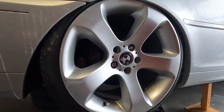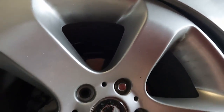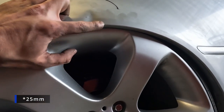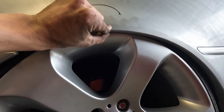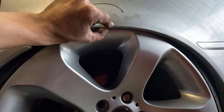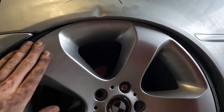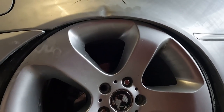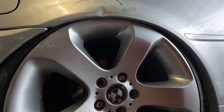Now I'm actually about to go in and roll the guards. As you can see, they're a decent thickness. I put the tape measure up and to the edge it's like 21 mil. So if you can knife edge this, you've probably got about another 18 mil of fitment you can get in there, which is kind of what I'm betting on. Let's drop this back down. I'm going to roll the guard in another video. Let's do a little time jump to after the rolling guard video and I'll show you what you can fit afterwards.